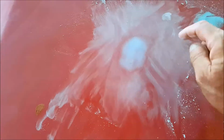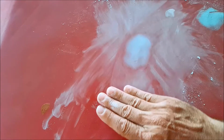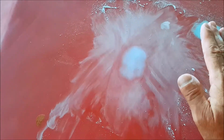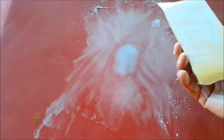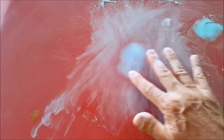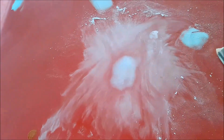And especially if this was metal and you had this situation and you kept sanding that down, it's like, oh, well, there's my repair and there's my repair. You've gone too far. The sandpaper will dig the filler out of the hole and not have hardly any effect on the sheet metal, and then you'll have a depression again to fill. So be very careful when you're sanding down your filler. Just sand it back until you see that little halo, because you're going to put primer.